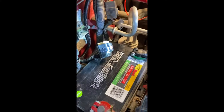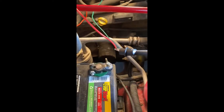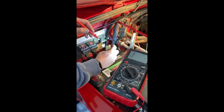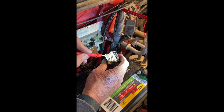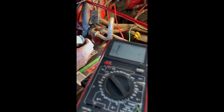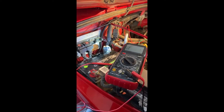I'm going to feed the wires up and over the back of the firewall. Now I'm going to check to make sure the pinouts go to the right wire — I have the red wire clipped to my ohmmeter. Red is supposed to be number 34. Counting over: 8, 7, 6, 5 — this is 34. That checks out. I do that with each one of the conductors to make sure I wired them to the right pins.